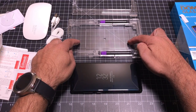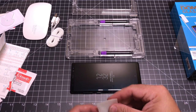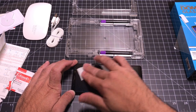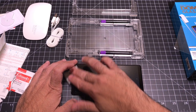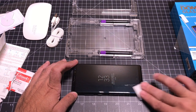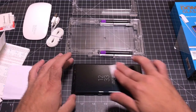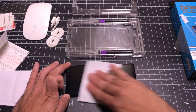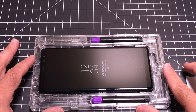Once it's clean, we're going to put it in the alignment tray and put the cover on it. The first step is to wipe down your phone — even if it's brand new and just came out of the box, you still want to clean it, because any residue is going to impact the adhesive. Wipe it down with the alcohol wipe, then use the microfiber towels to dry it off. Now I have it in the tray and gave it another inspection to make sure there isn't any dust.